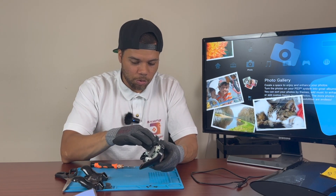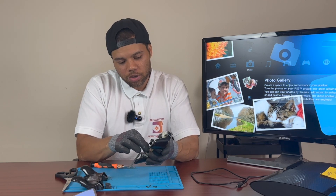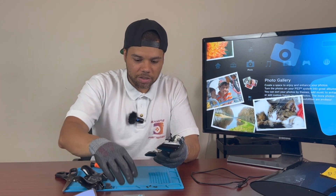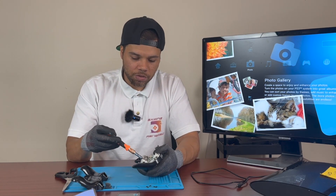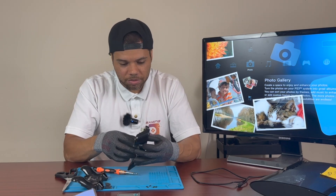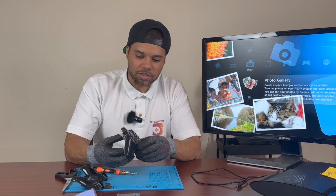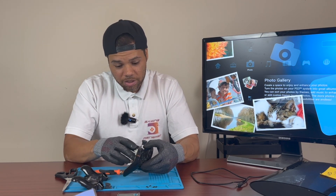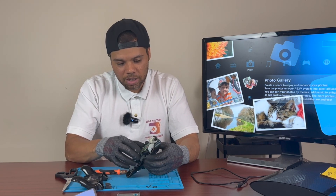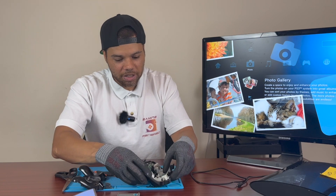This controller is quite dirty but we're not going to focus on cleaning it in this video — this is just about the fix. Go ahead and pop the battery out. The only other issue I've ever come across is the battery won't hold charge anymore, so sometimes you'll have to replace it, but they're usually pretty bulletproof. There's one screw right here that you have to take off to basically remove the board, and then you are at the little ribbon cable I was telling you about.